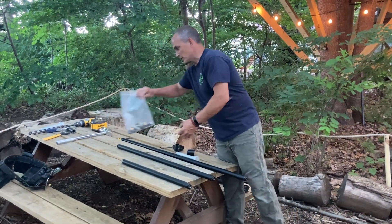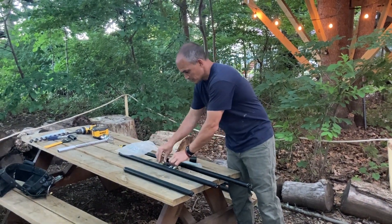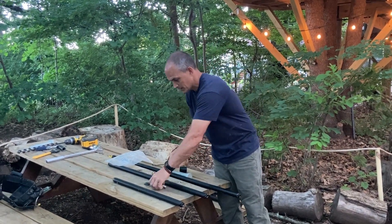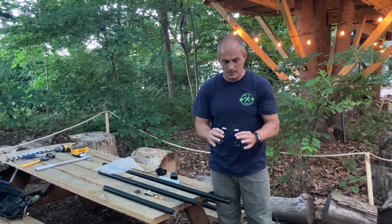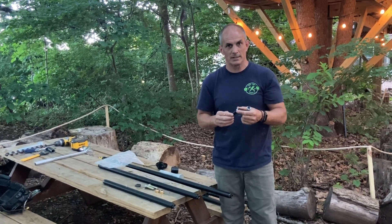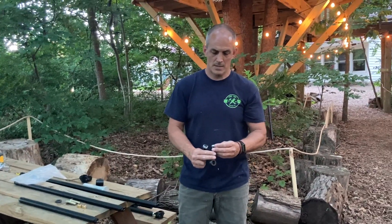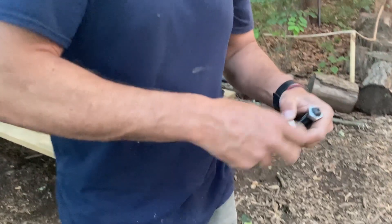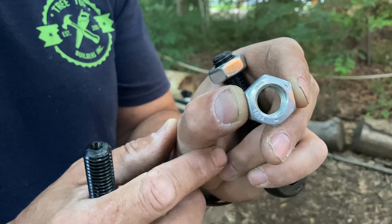When you purchase an MTAS strut, you'll receive a bag of hardware containing the following items: four nylon spacer washers, two gold grade-eight high-strength bolts, two gold grade-eight high-strength lock nuts, and two rod ends. These are very important — they are right-hand and left-hand threaded, and they come with jam nuts, the little silver ones, which are also right-hand and left-hand threaded. You can't put a left-hand nut on a right-hand bolt and vice versa. The way to tell the difference is the left-hand nut will have a mark with an arrow showing the direction you have to turn it to tighten it, which is lefty tighty, not righty tighty as a normal right-hand nut.